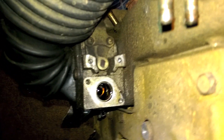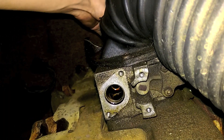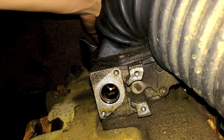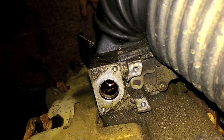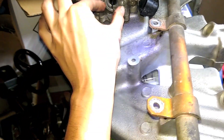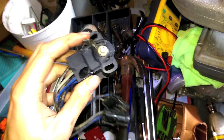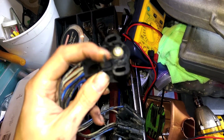With the TPS sensor out you can see what the old throttle body looks like. It's got a swing arm that would rotate to activate the TPS, and the holes are also wobbled out so you can adjust a little bit. With the newer style there's no adjusting — it just attaches on there and it's a direct drive instead of the older one which uses this little tab.